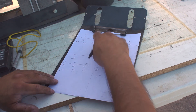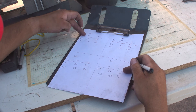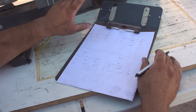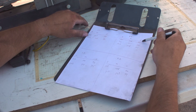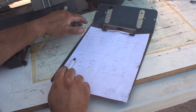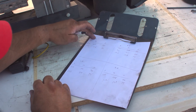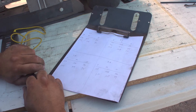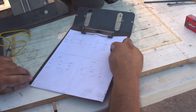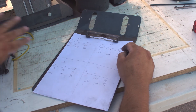I've got a clipboard with a sheet divided into quadrants representing right front, right rear, left rear, and left front. To keep this consistent you've got to practice — it takes a little time. I start on the right front outside, middle, inside; go to the right rear outside, middle, inside; hop to the left rear outside, middle, inside; then the left front outside, middle, inside. Last, I go back to the right front outside and check that number against what I originally started with — I was at 101 when I started and 100 when I finished, about a one-degree cool-off through the whole cycle.